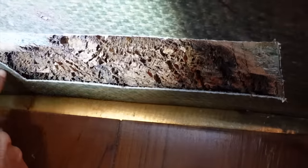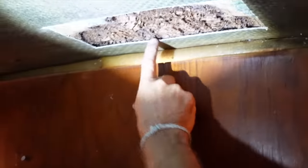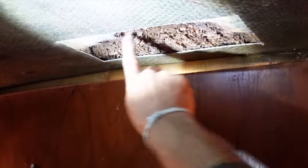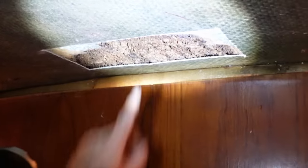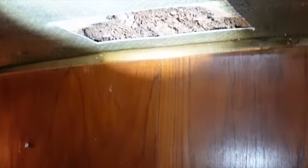I've got a little bit of digging to do here and obviously the way back to the hatch will be all rotten. So we're going to replace this. That's solid there, solid here. You can see where I've got to replace — I'll probably cut all that timber out anyway and bring it back to some solid timber. Straight to the hatch will be all new. We'll get our G10 board in there. You can see the water — it's gotten all through that, all because someone didn't seal that opening properly. Let the fun begin.